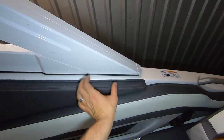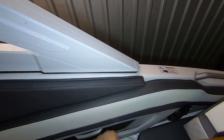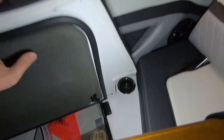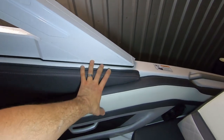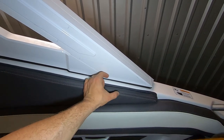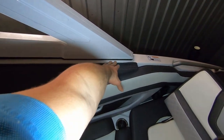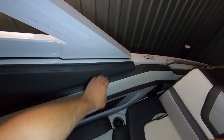This is how I shaved the wire: I pushed the guide wire — fishing wire — through fine, but then when the cable started coming through and I kept pulling from below, that sharp aluminum block was shaving the cable. After that I had to replace the cable, which was costly. Then I removed these panels, got to the access hole, stuck a ratchet in there, loosened that last nut, and turned that aluminum block away from the hole. Once finished, I repositioned it and tightened it again. That's a necessary step to run all your wires through here — you'll have four thick cables and need all the space you can get.